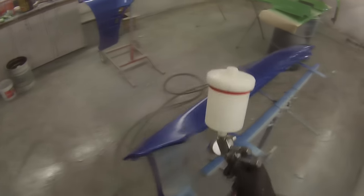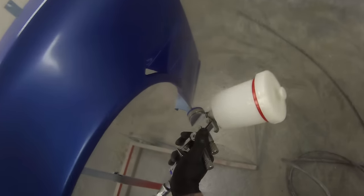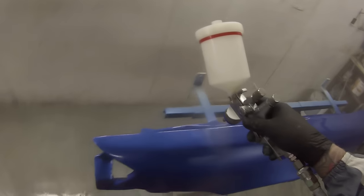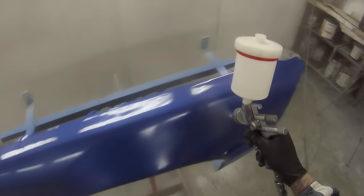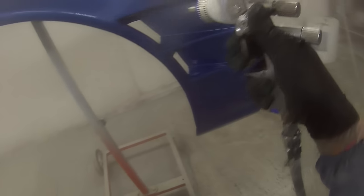As you can see, I used that mini gun just to get into those little vents to stop it from running like it did last time. I could have wound the fluid in and pulled the fan back, but it was easier and more precise with the mini gun. I don't use it very often but it worked fine — no runs around that area this time. I'm really hammering that clear on; I wouldn't usually go that heavy, but I'm trying to fill up those 200-micron flakes.